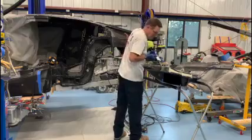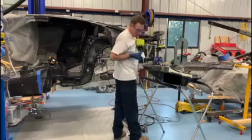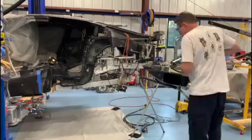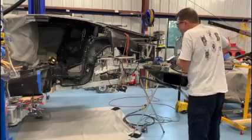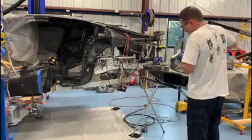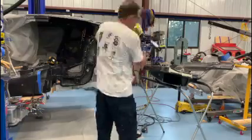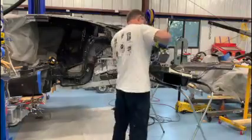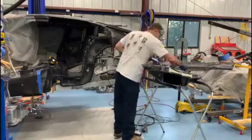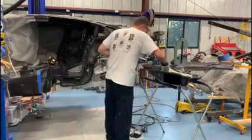I did it in this lower door jam area and also in that upper pillar area, so I've got the body of the car all epoxied where my receiving surfaces will be. I really wanted to make sure I had enough coverage so that when I put everything together I get some squeeze-out from that joint — to make sure it's got good coverage. So I additionally put beads of epoxy down on the quarter panel and smooth those out with a popsicle stick as well.